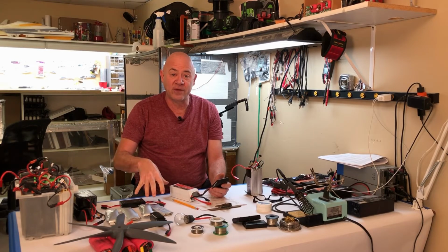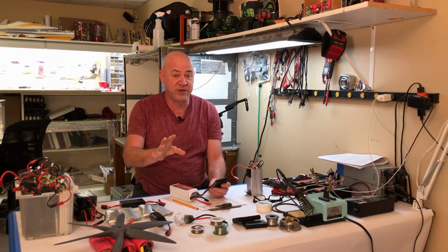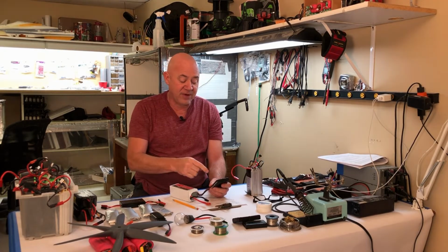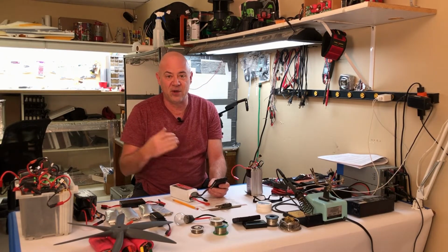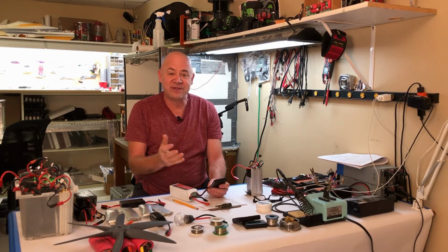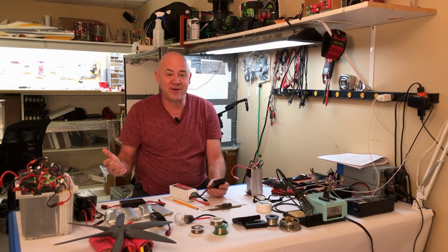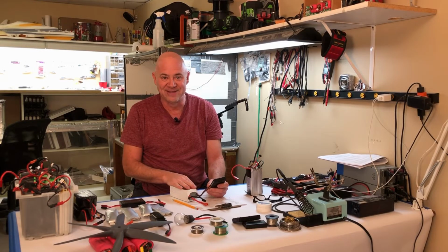Now, 3 of us are holding the airplane. I'm holding this. Nobody's near that big 32-inch propeller, okay? We run it up. Everything went to 3.8 volts. And then the low voltage cutoff started kicking in and out. And I'm like, whoa. He says, dude, your batteries are done. They're toast. And I'm like, I've only got like 340 flights on it. And everybody starts laughing. They go, dude, nobody gets 340 flights on LiPo batteries.